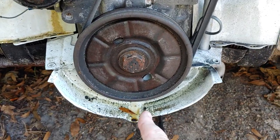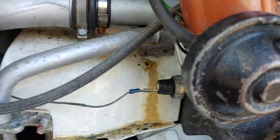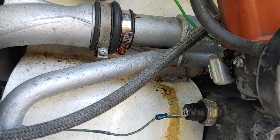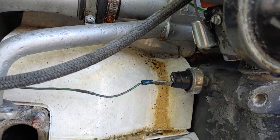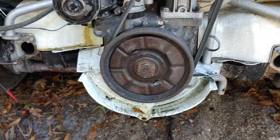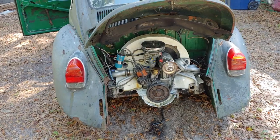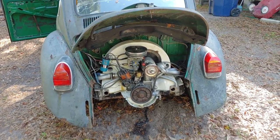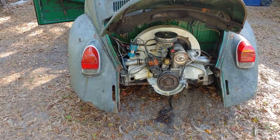I do have a crank oil seal going bad, and the oil cooler seals, those little donuts, are going bad also. So I don't want to run it too much like this. It's probably not healthy for the car to run like that, but that's where we stand. This is the first day I've really had a chance to work on this car. So comment below if you think I'm on the right track. Comment below if I'm not on the right track.